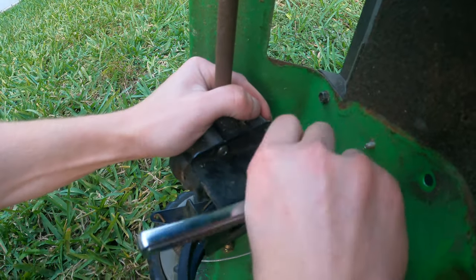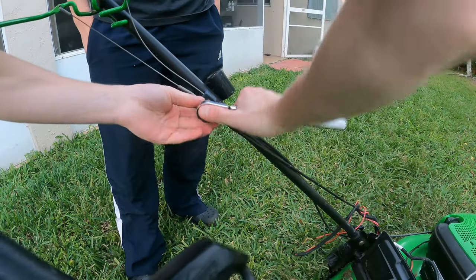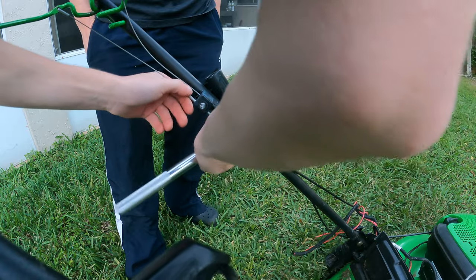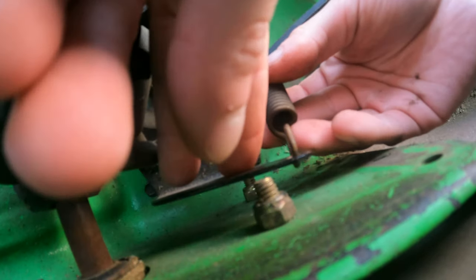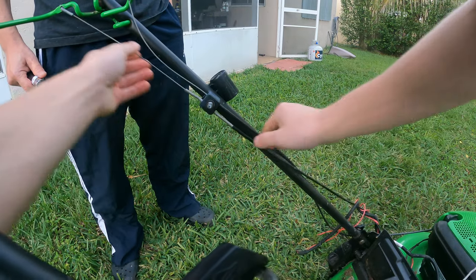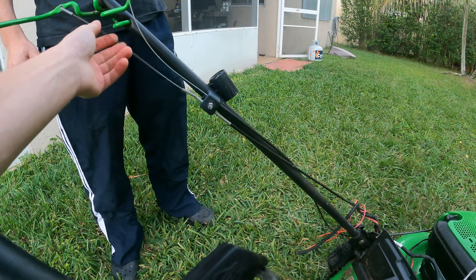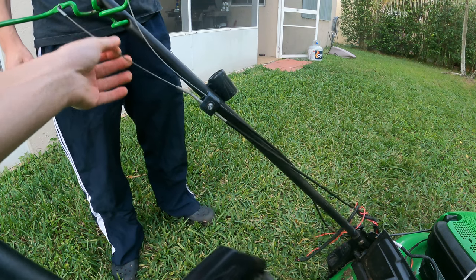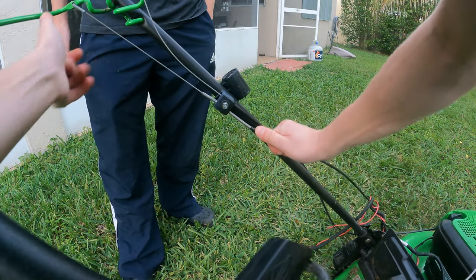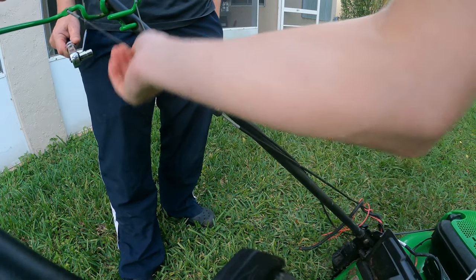Please give us a like if this helped you. As you can see, I'm tightening everything up, and up here on the handle you'll see there's a little release for the cable that will allow you to get this spring onto the transmission very easily. You want about that tension when you tighten it back up — you don't want it to be too floppy, nor do you want it to be very taut. When it's too taut, the drive belt is engaged and you'll constantly be going forward as soon as you turn on the mower.